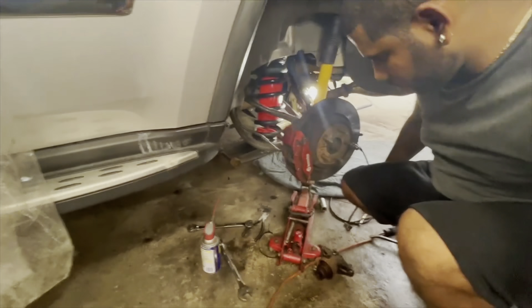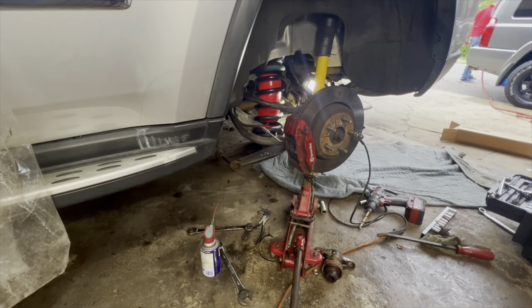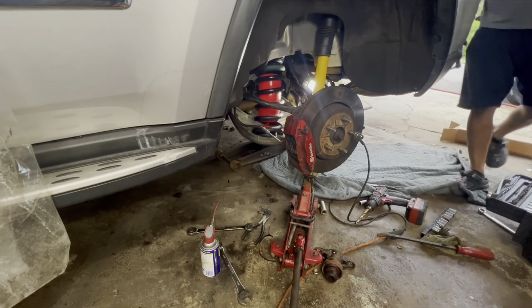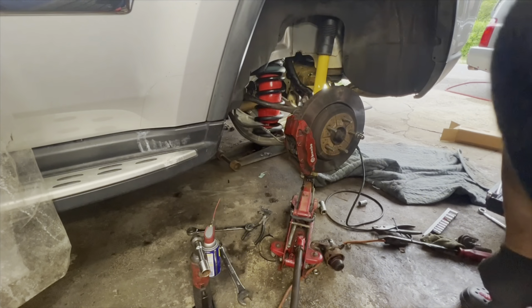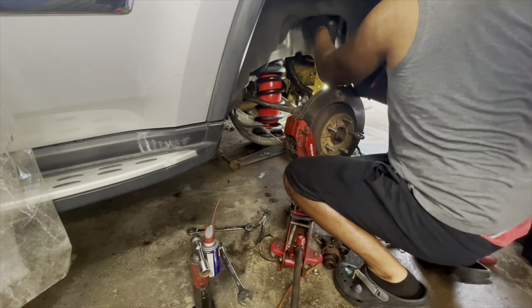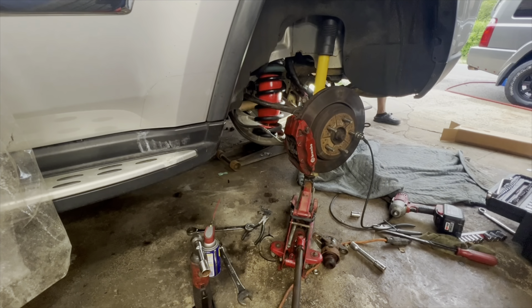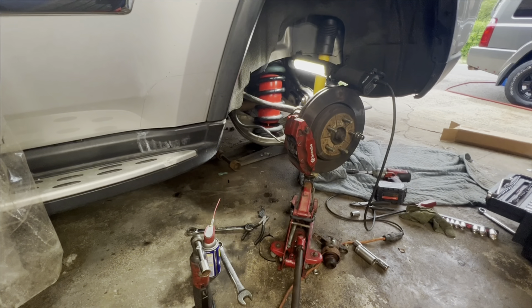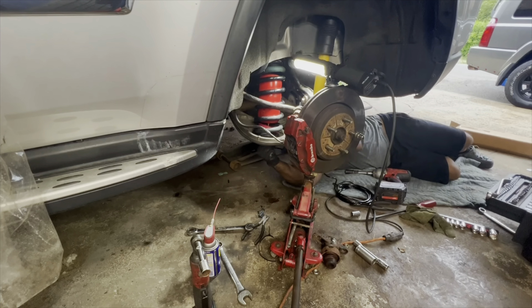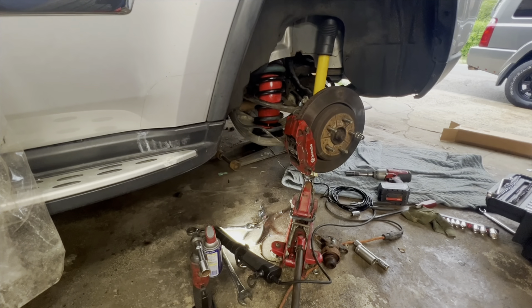This is the final step — all you have to do is reverse the same steps you used to take the strut off. You will also need a jack, as the new strut does not fully reach up. You can try to lift it by hand, but I'm big on preserving your body, so I got a little jack to get some thread of the bolt in. Then move forward to connecting the airline to the bag — this step is the hardest as you don't have a lot of space to fit any tools.